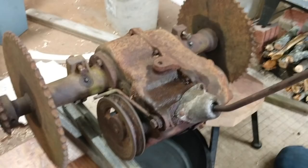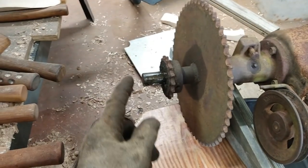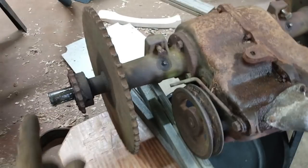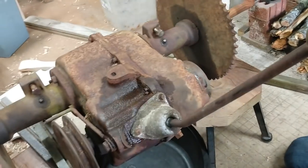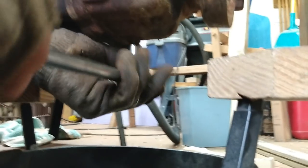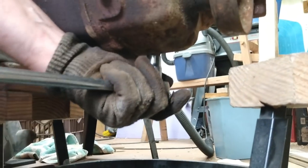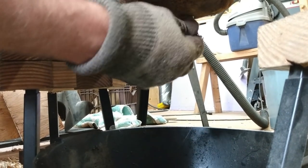We got the transaxle out — it was pretty easy. I took the chains loose and loosened the three nuts on these outer bearings and they slid out. I soaked it in that good GM lube and it came off. Now I'm going to pass the phone over to my son and we're going to drain this thing. I got a feeling this is going to be pretty milky because this thing sat outside.